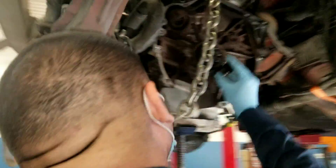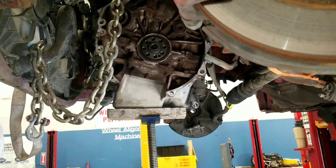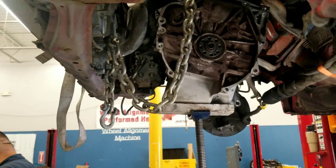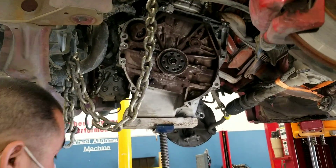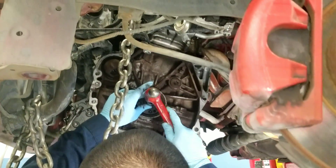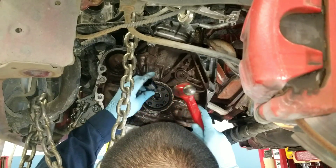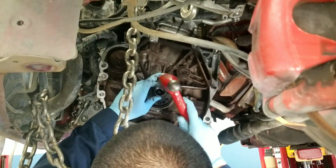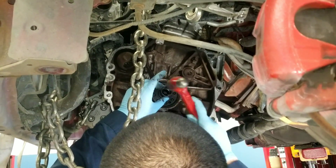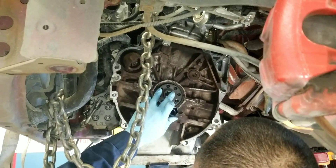You see that? Sometimes I use a bigger one because if this is the same size as the ring, you can push it too far — all you want it to do is seat, not overshoot. That's why I use this backboard and then I use this hammer here. So you just tap it. You're gonna hear a different tone whenever it's all the way in. You hear the different tone? Yeah, yeah — hear how it sounds solid? Now it's flush.